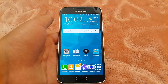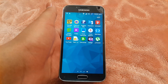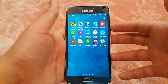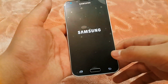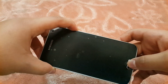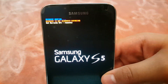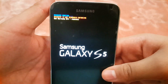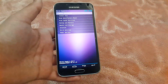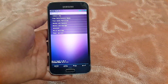The gallery app and every stock app is working just fine. Now let me show you how to install it. First, power your phone off, then hold Volume Up, Power, and the Home button at the same time to enter recovery. Note: if you rooted your device without a PC and can't install a custom recovery, I have another video showing how to install a custom recovery on the Samsung Galaxy S5 without a PC — you just need a rooted device.